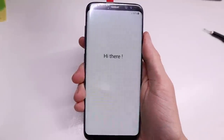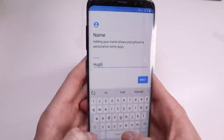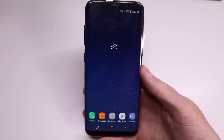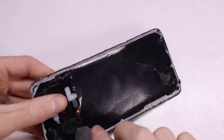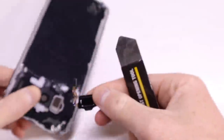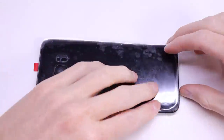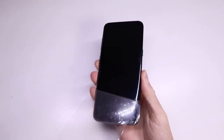The phone successfully booted up and I was greeted with the Android setup screen. I proceeded to set up the phone and test out some basic features — making sure the touch was working, all the buttons were functioning, things like that — before sealing up the phone. To install the back cover I first had to remove the fingerprint sensor from the old back panel and transfer it to the new one. I heated that up with my heat station and easily removed it, then placed it with new adhesive onto the new back cover, making sure it was aligned correctly. I plugged it back into the motherboard, sealed up the device, removed the plastic film protectors on both back and front, and we're done.